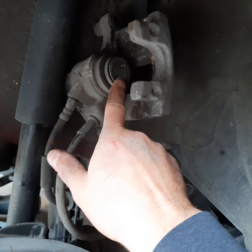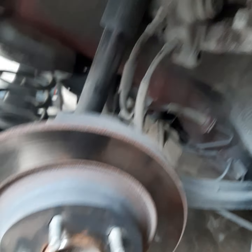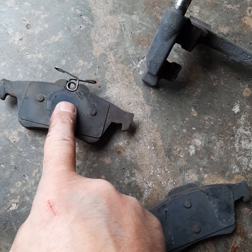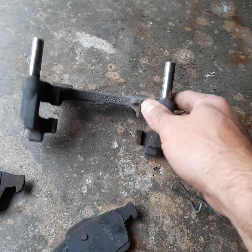You're going to put brake lube on the piston, on the inside of the caliper where the pad makes contact, and on the bracket itself — all four corners. Anywhere there's a part moving, it needs to be lubricated with brake grease. They make brake grease specifically for brakes. I want to use the right tool for the right job. Don't put brake lube on the rotor face — I've seen people put grease there, which gives you what I call the slippery brake — the exact opposite of what you want.